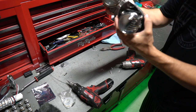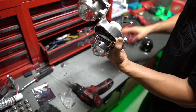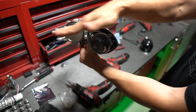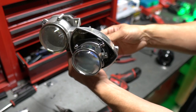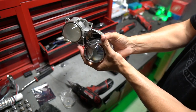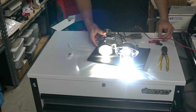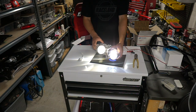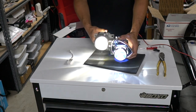Not bad. I can't tell how aligned it is, but I can test fit it. Since this projector is higher up, it's going to have its line as the primary, the predominant one. This one will tuck right underneath that as the secondary low beam line. All I need to do is put the bulb back in, tighten it up, and we'll turn them on. So we've got both LEDs on — this is a bulb with a little fan behind it and this is a monster.